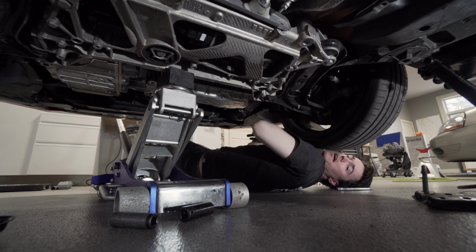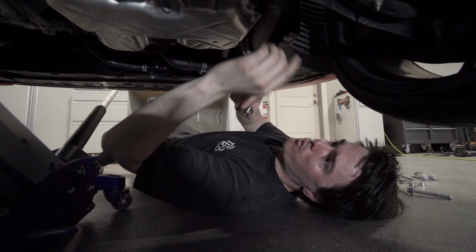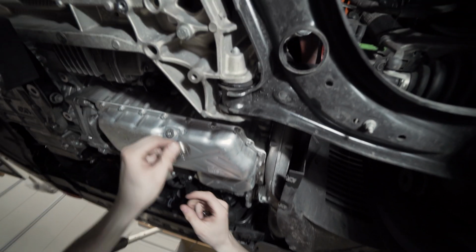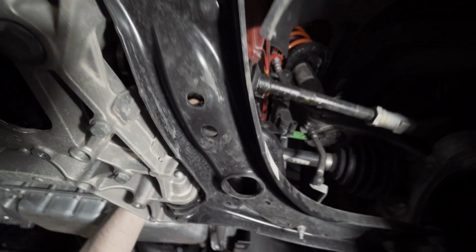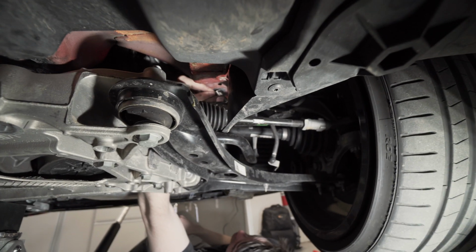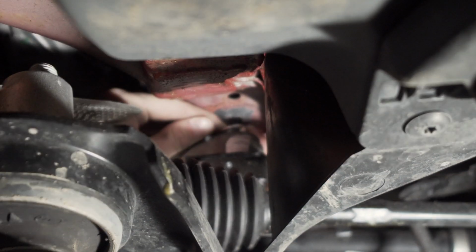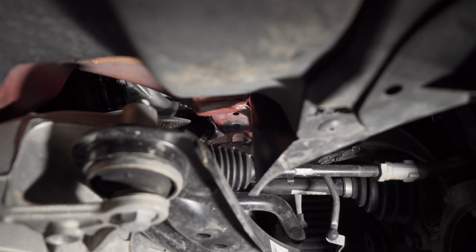I'm gonna keep putting my head under this wheel. I don't know how well you can see here. So these are the front subframe. We're taking the 601-0029 collar. Oh wait, I can see it from back here. And inserting it into the top of the front. And I want to make sure I get it in. She's in. It press fits real nice. Centers up. Do the same on the other side of the car.